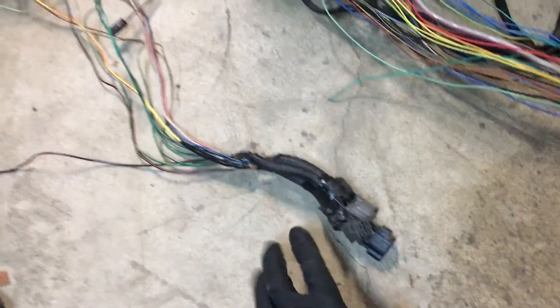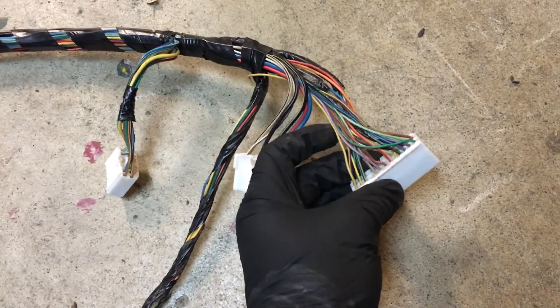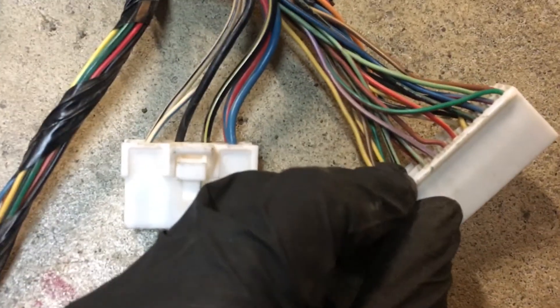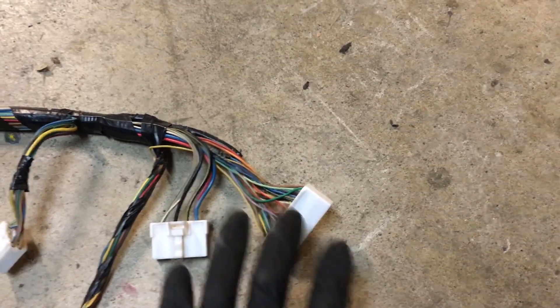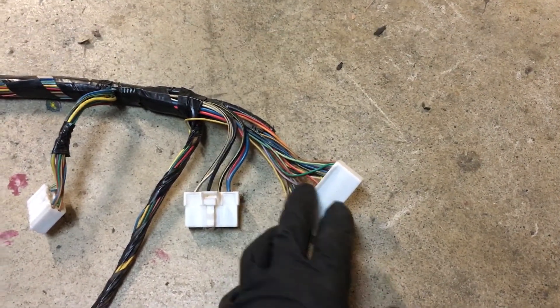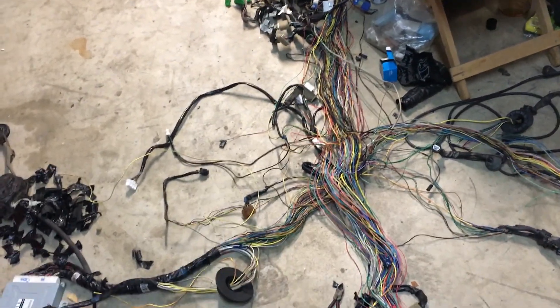I have that off to the side. For this SMJ connection, this is what we want, and then these connections we want to take back to the ECU. I think these are the connections to the right of the passenger seat - not sure if it's this purple and green one, I'll need to confirm - but I think that's all we need to connect to the fuel pump controller. I'm going to grab the fuel pump controller from the car another day, connect this here, figure out which wires to pull, then pull those back to the ECU and cut off all the wires I don't need.